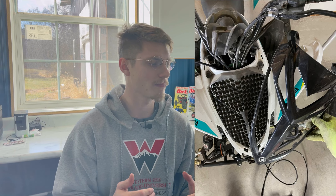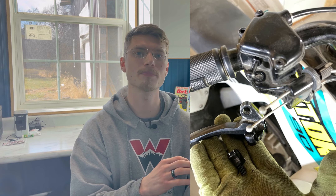But once you've loosened up the whole assembly, the next thing you're going to want to do is loosen up and remove any plastics around the handlebars of your quad — really just anything that will allow you to feed the lever up through. Removing and loosening these components makes it easier to work around this space of the quad. Once this is all loosened up, you can feed the stock brake lines up through and disconnect them at the stock brake lever.